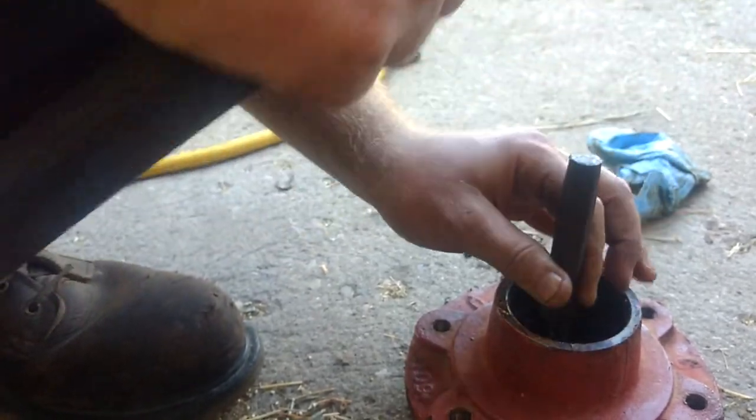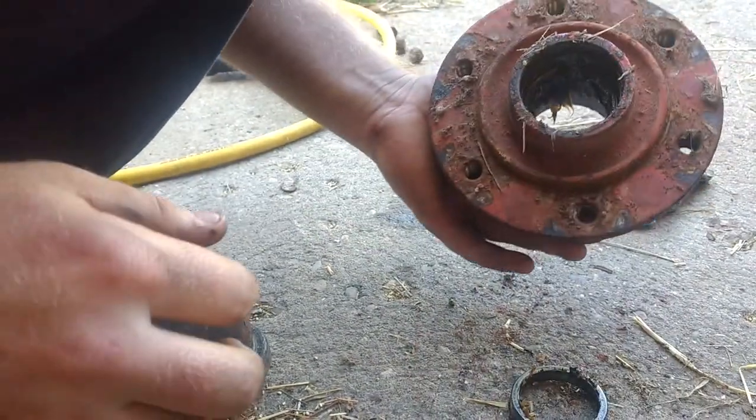To get the race out, this hub has notches in it specifically designed for this. Find them with the chisel so you can get in on the back side of the race and tap it out gently — it's got one 180 degrees out on the other side as well. Got it knocked about halfway out, then flip it up on its side to get it the rest of the way out. Turn it over, get on the other side. Got that one out easy enough. Wipe it off so I can show you — that is bad wear in that race. Let's get this other race out the same process going the other way; should come right out.